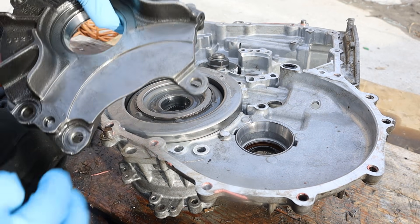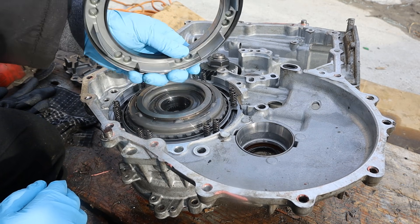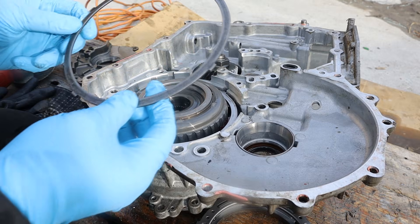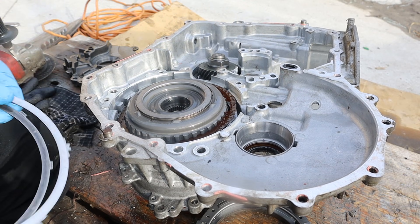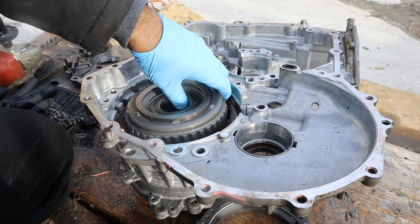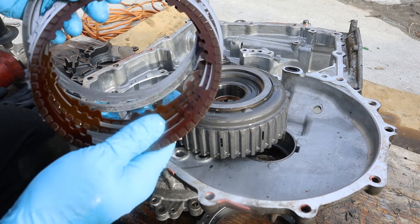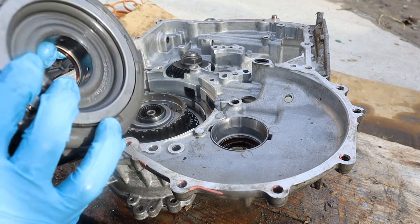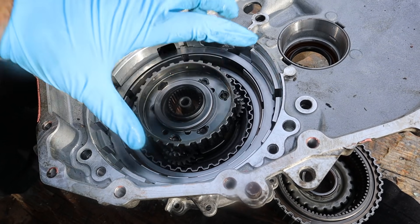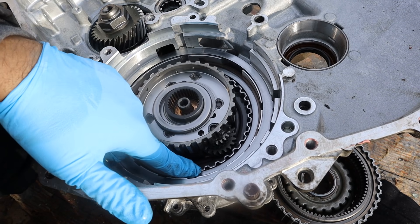This giant piece basically takes hydraulic fluid from that pipe we took off earlier and sends it through to this piston over here. This piston controls the planetary gear set — there is one planetary gear set inside of here — and it controls reverse and a high-low. This is the return spring that will spring the piston back into place when hydraulic fluid is released. These clutches actually brake along the outside housing of the transmission. What that's going to do is stop the planet carrier or the ring gear from rotating, and that's what's going to give you reverse. Here you can see it is actually the ring gear being braked against the transmission housing. Furthermore on the inside here you can see another set of clutches, also activated by hydraulic fluid through these little holes from the shaft, and there's a thrust bearing on there too.